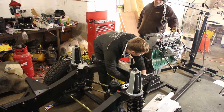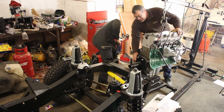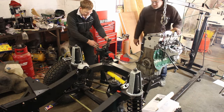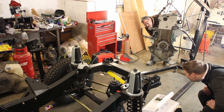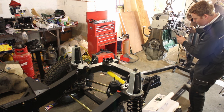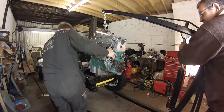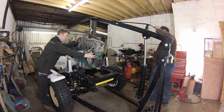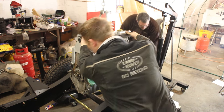I'm undoing the four bolts from the back face of the engine to free it from the stand — also from SGS Engineering, well worth considering if you've got any amount of engine work to do. This job is easier if you have two people: one to guide the engine and stop it from swinging, and the other to operate the crane. The engine needs to be lifted clear of the front chassis cross member that runs between the dome irons, then rolled into place accounting for the arc the boom moves in as it lowers. Then we inch it slowly onto the mounts, and finally our Land Rover has its power plant back.